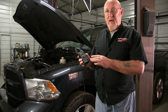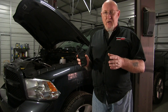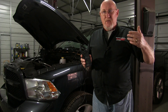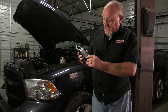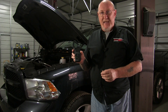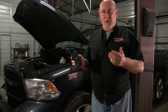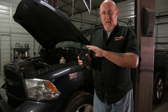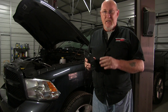We also want to check the scaling. This tool converts current to a voltage output, and on the PicoScope there's a dropdown menu to select the 600 amp clamp which automatically resets the voltage scaling. The scope I'm using this morning doesn't have that feature, so we handle it manually. On this tool, one millivolt equals one amp — so 50 millivolts is 50 amps, 100 millivolts is 100 amps, and so forth. Since I know that conversion I can make the adjustment, but today I'm really just looking at the pattern and the changes in demand.